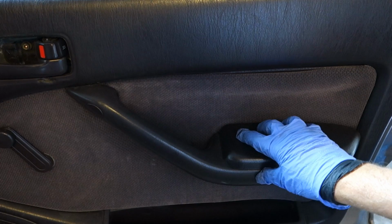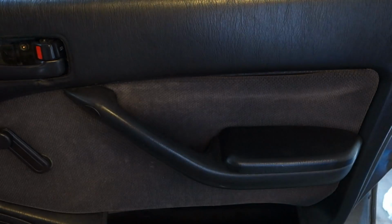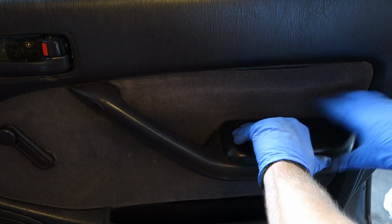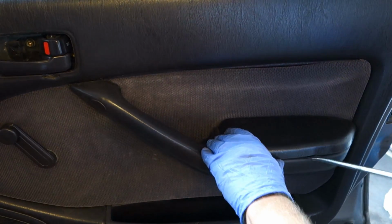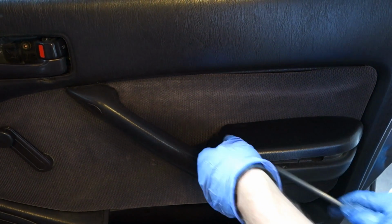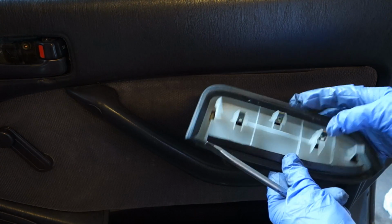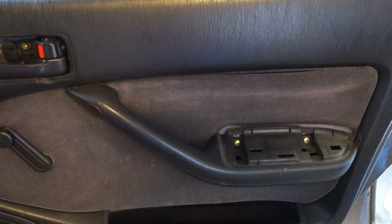Okay, and then the door handle replacement. There is that part and then that part, and I start my job in here. The idea is to lift that cover using only hands, or a flat screwdriver, and this opens carefully. I lift it carefully up, and now all of these plastic fasteners are okay, and I managed to do that job well.